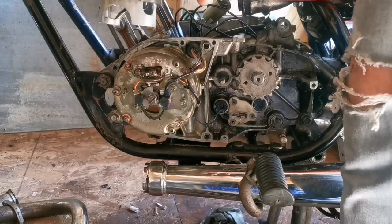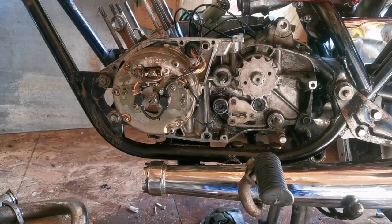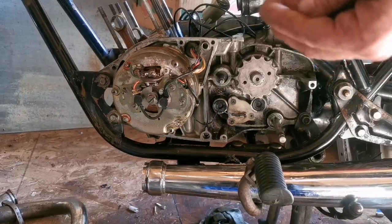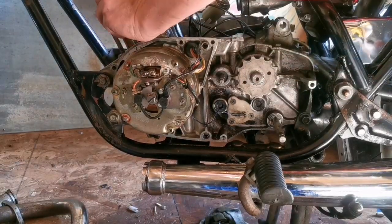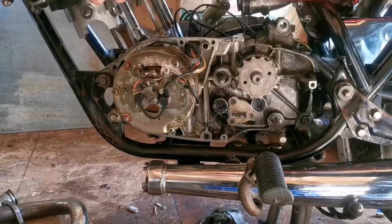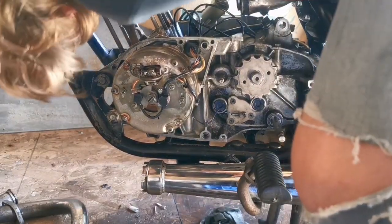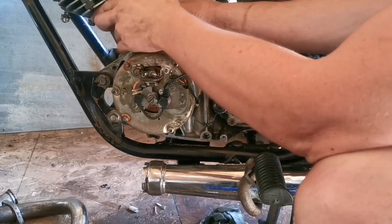Cylinder, piston, it's in the top. We will get a needle bearing. Where did I put it? There. And circlip. And we'll put this. Okay. Circlip, needle bearing. Needle bearing goes in. Pin is in the piston. Just gently go over. Make sure it's all in place without screwing the gasket up. That's really important on this one since the gasket's already been screwed up.